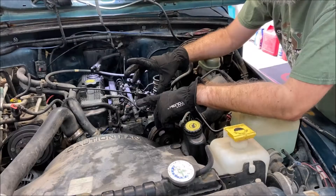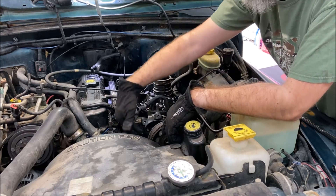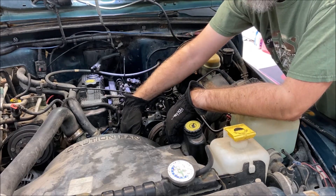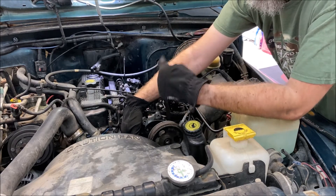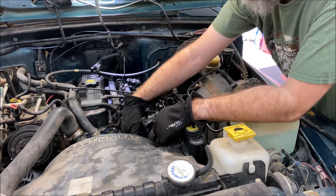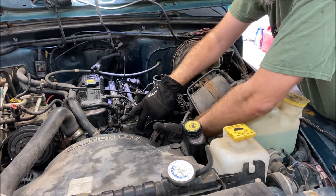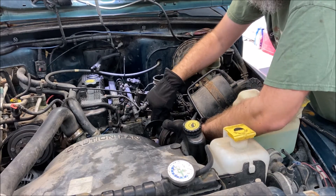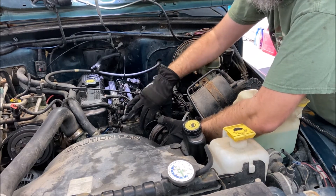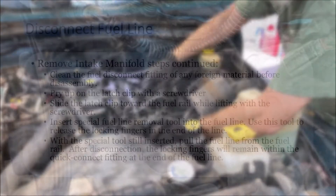Just so you know, there are three bolts for the steering pump — two are easily obvious at the top, but there's one on the side as well, at about the seven o'clock position if you're looking from the front to the back of the Jeep. There are three bolts total; it'll drop down out of the bracket and then you just need to pull it aside and zip tie it out of the way so it doesn't hang on the hoses.